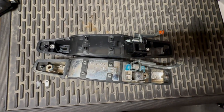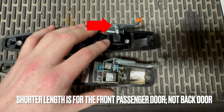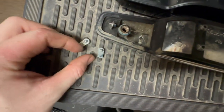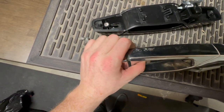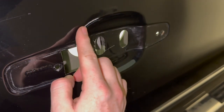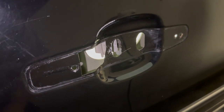I want to compare the old door handle with the new one — they look exactly the same, but you can see some corrosion on the springs of the old one. For the piece that broke, you can see the two broken pieces that fell out of the door handle — that's why that side was so loose. Someone grabbed from one side of the handle over time and it broke. Now that it's cleaned up, I did notice some wear where the door handle mates the surface, so I'll put some touch-up paint on that to prevent rust before putting the door handle back on.